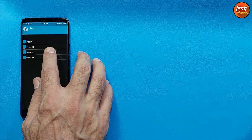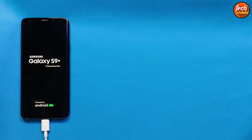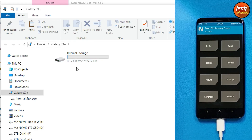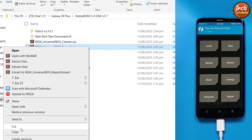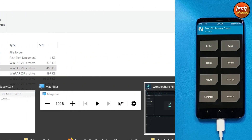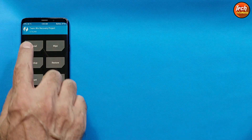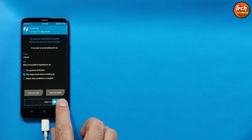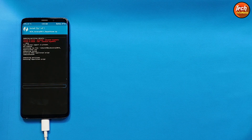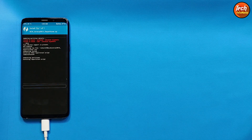Go back to main screen, tap Reboot and tap Recovery. If the mobile shows 'No OS Installed', that's fine — just swipe to reboot. Swipe to allow modifications. The internal storage will appear on your computer screen again. Go to the downloaded folder and copy the repartitioner file. Go to the internal storage of the mobile phone and paste the repartitioner file there. Come back to the mobile phone screen, tap Install, select the repartitioner file, and swipe to confirm flashing. The mobile phone will automatically reboot when the flashing of the repartition file is done.